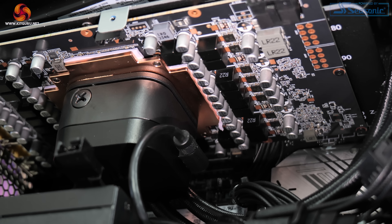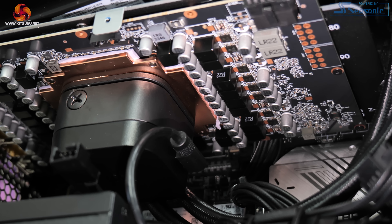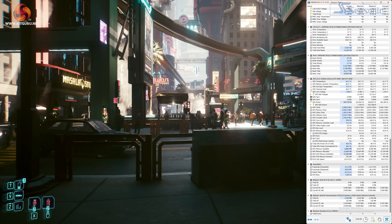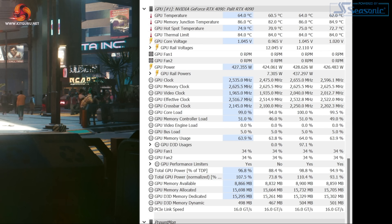One other key area I really wanted to expand on from my original video is the GPU VRM situation. As I pointed out, there are no heatsinks or anything like that for the VRMs on this RTX 4090 — they are just completely uncovered and rely solely on system chassis airflow for their cooling. I since acquired a thermometer with two K-type thermocouples and attached these to MOSFETs on the GPU — one on the left hand side of the GPU core and one on the right side. For testing I used Cyberpunk at 4K but with path tracing enabled to increase GPU power as high as I could, seeing power reporting around 420 watts — a pretty intense load.